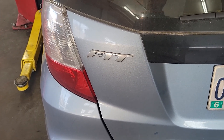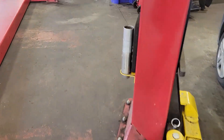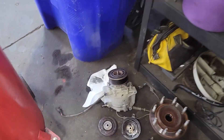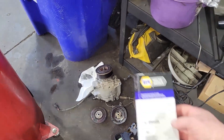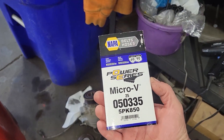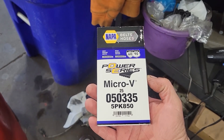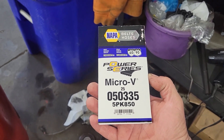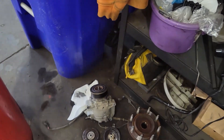2011 Honda Fit 1.5 liter. I don't know if they all have no power steering. This one has a bad compressor. I was able to get this belt on — 25050, 335 belt, or 5PK850 belt. We were able to get this on and bypass the AC.